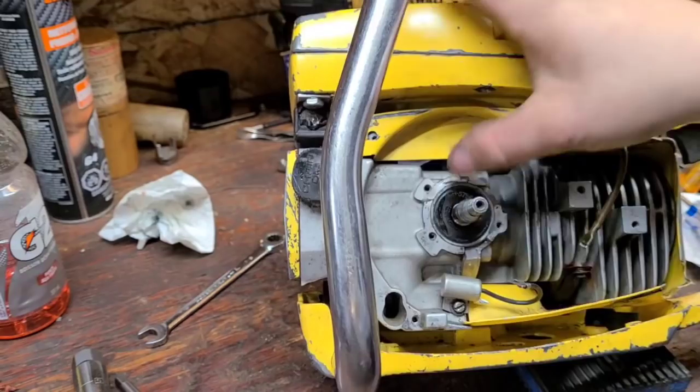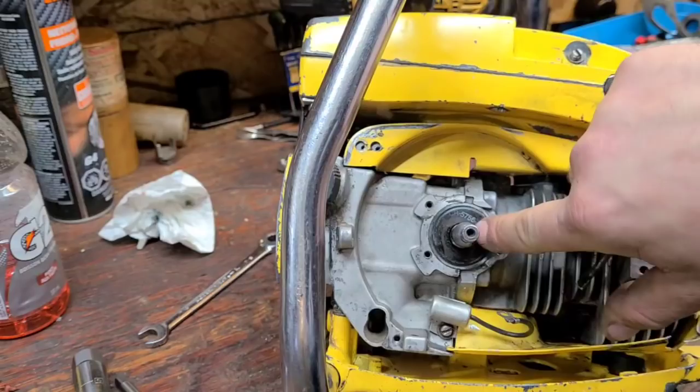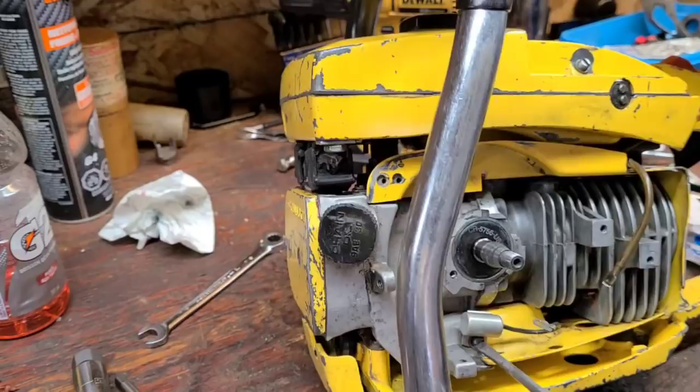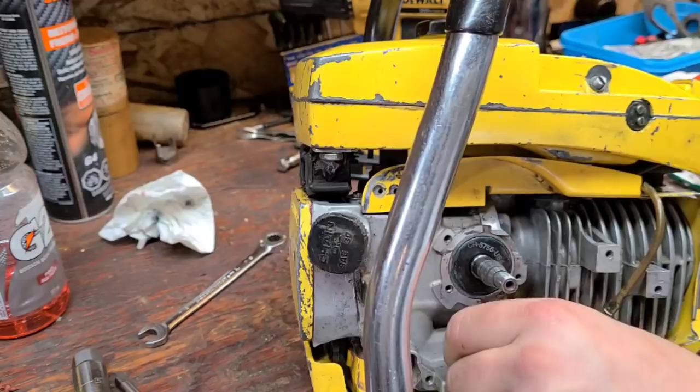If you guys are looking for a PTO or a flywheel side seal, CR5756 Chicago Rawhide, that is a standard seal that you can buy darn near anywhere. They are kind of hard to find, but you can order them. They're like 10 bucks if you don't want to go NOS. I don't do NOS seals because I find they're a little overpriced a lot of times, and they're 30 years old. Sometimes you get them and the rubber's no good, and you spent 30 bucks and you still need a seal. So, whenever possible, I will order a new seal.